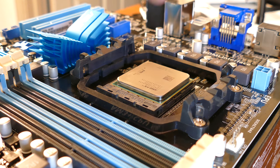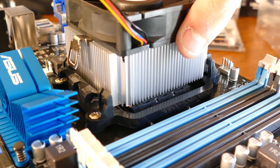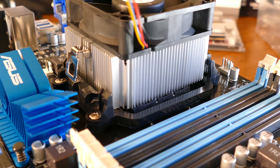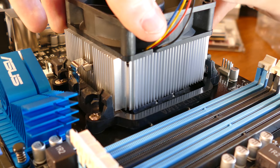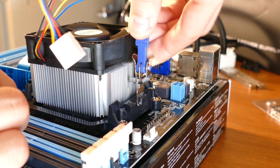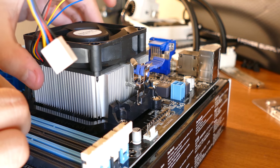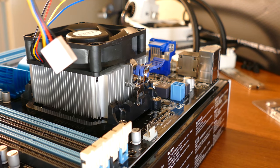You've installed a CPU. Grab ahold of the stock cooler, or whatever cooler you intend to use, and prepare it for installation. If you're using a third-party cooler, refer to its corresponding manual. For this stock cooler, all we need to do is latch both ends of the beam underneath the black mounting points. Once both ends are wrapped around these points, rotate the black lever on the cooler 180 degrees. Your cooler should now be fastened tightly to your CPU and motherboard — you can use it as a handle to lift and move your motherboard from now on.